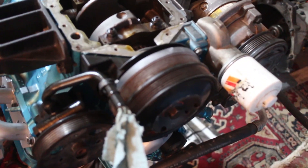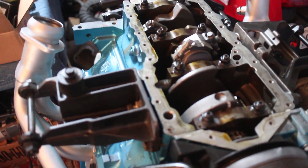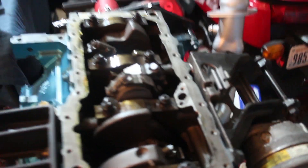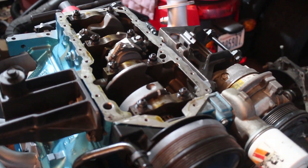I do have a degree tool — we used that when we torqued down the rod caps. I'm just going to wedge my pry bar in between here so it doesn't rotate the engine, that way I can get it all torqued. Then I'm going to get the oil pan gasket and the oil pickup tube — it goes right there — get that bolted down. I won't be able to put the pan on just yet since I do need to clean it out, but we're very close to getting the oil pan on and this engine is ready to go onto the Camaro.